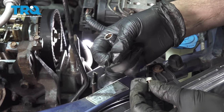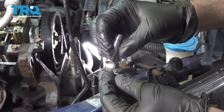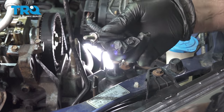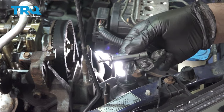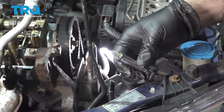I actually took an old rubber glove and I cut one of the fingertips off. And I'm gonna slide my socket over there. And that's gonna hold my bolt from falling out. So now I can reach the socket in, thread that in, and then pop the piece of glove and the socket out. So let's go ahead and get this installed.